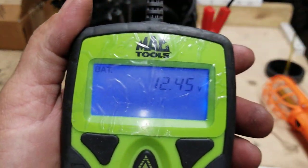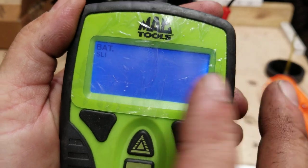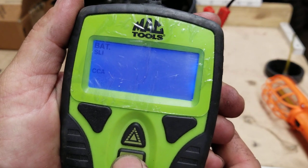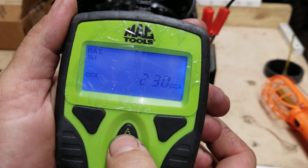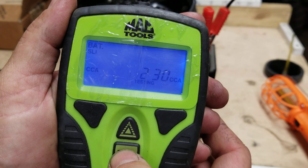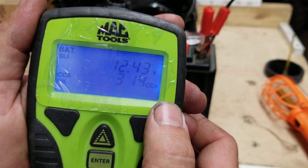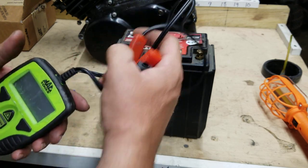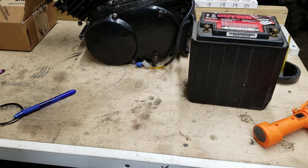This is going to tell me the voltage. You click enter and it tells you it's a liquid-fill battery. It does AGM and everything. You select your cold cranking amps — it's a 230-amp battery — click it, it tests the battery and tells me my battery is good, reading 314 cold cranking amps. You compare it to the cold cranking amps on the battery. This is my 12-volt test battery and I'm going to show you guys some cool stuff with it tonight.